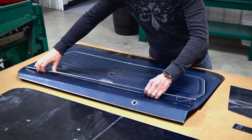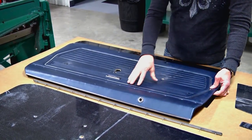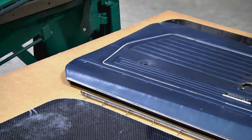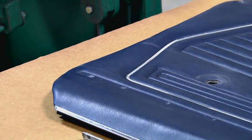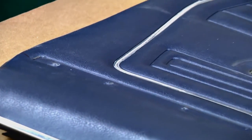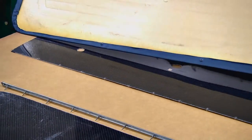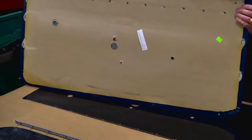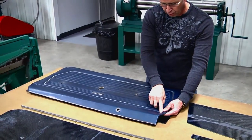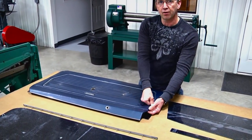We're going to replace the bottom part of the door panel, so we need to cut this off and separate these two pieces. We're going to cut this door panel at the bottom of the line where the stainless steel trim went through, so we can slide the carbon piece up under that and fasten it down. Then we're going to use the stock fastening hardware to put the bottom of the door panel back on. These basically just have a cardboard-type backer which is really easy to cut. If you cut the vinyl down at the bottom and cut the cardboard up a little higher, when you put the carbon in there it will pinch it down flat so you won't see the transition — it will just smooth right over and blend into the door.